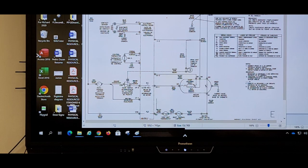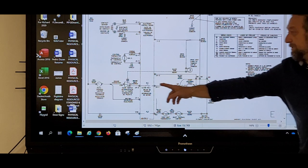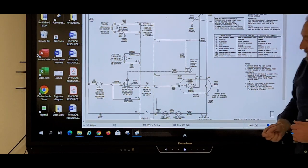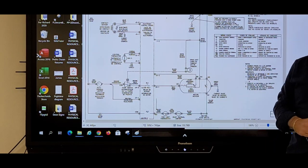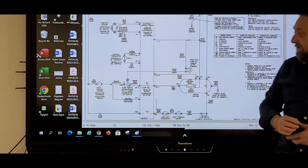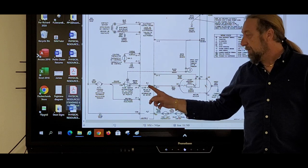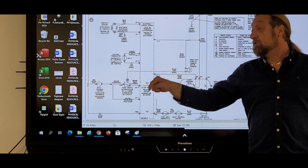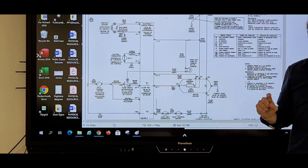No, you got to press start. I got to start why? Because this relay has to close. But once you jump it, it should automatically close, right? So once you jump it, it should automatically close, right? When I jump it, I'm sending power here, but this relay will not close until I say time dry and start. So it has to be on time dry.